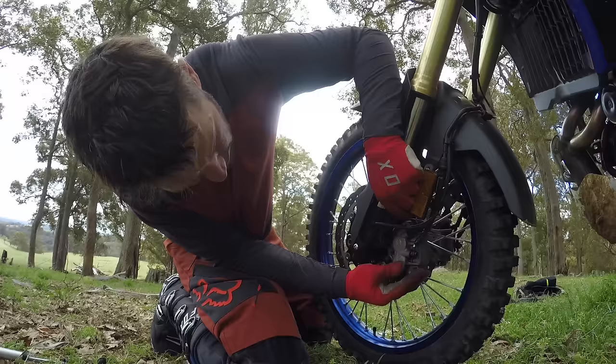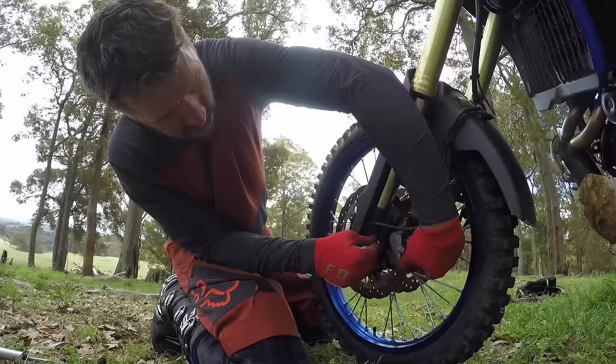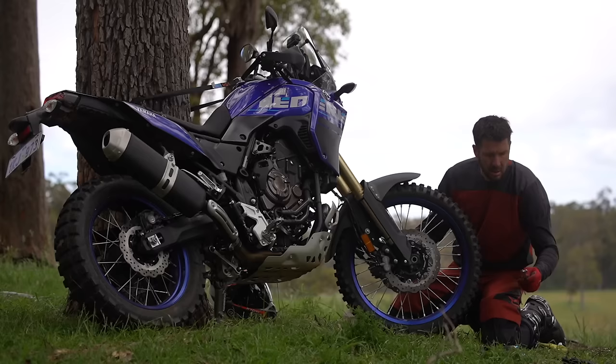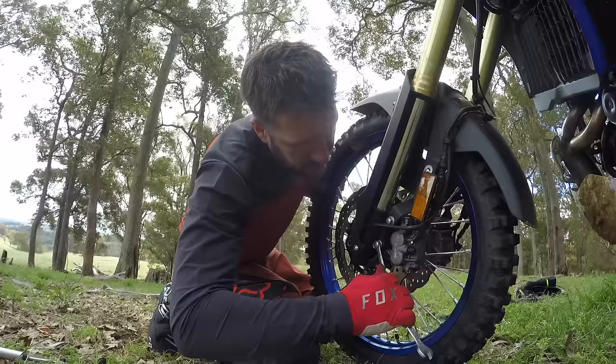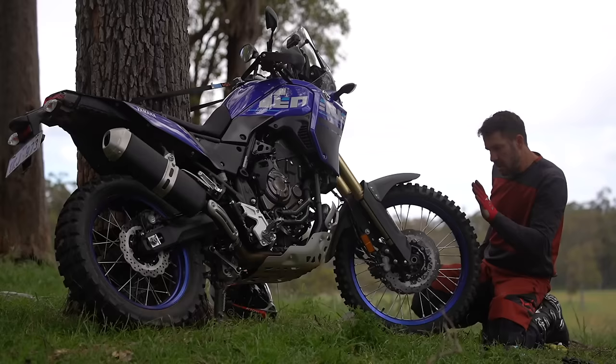Start that with your fingers, just so you know the thread's not bound in any way — it started perfectly before you crank into it. This is the most important part of getting your front wheel in: remembering to do your axle up all the way home. People are going to start talking torque wrenches and all that, but if you're a dirt bike racer, especially enduro, the amount of wheels you've done up in race conditions — it's just got to be tight. With that leverage, that's good. Everything's home, it can't go anywhere. Get the other caliper on — take your time, eye it up, you don't want those pads to dislodge.